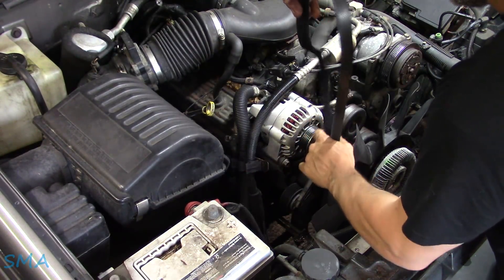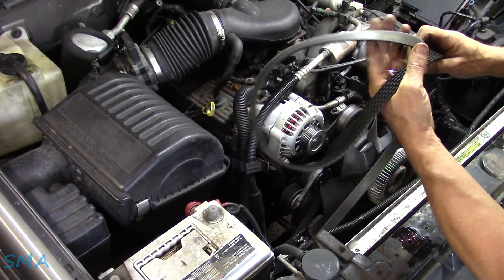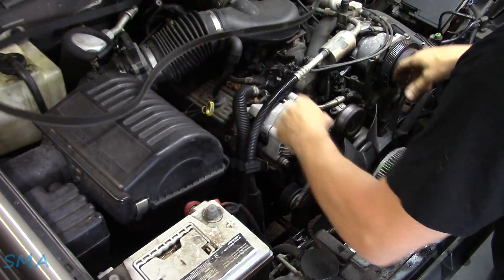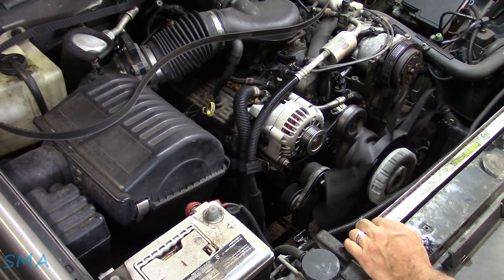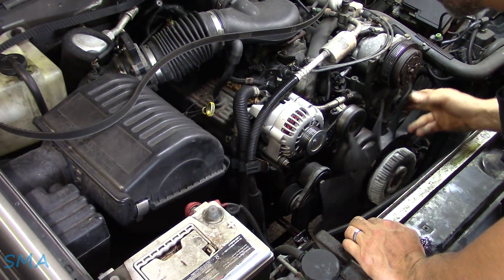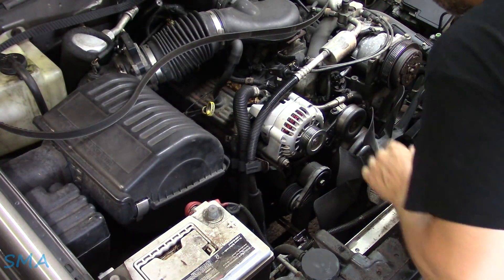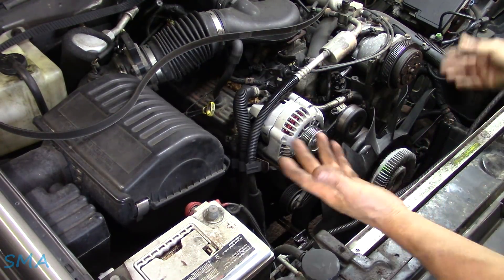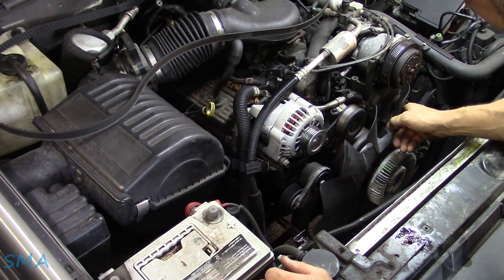Keep track of which way this belt's running. Of course, this one's been soaked with coolant, so it's probably going to be noisy anyway. We're going to have to get the fan off — I'll see if I can get something to hold that. It's got some oddball bolts in the pulley there. Somebody's definitely been in there before. Of course, being 22 years old with 200-plus thousand on it, definitely not its first water pump.